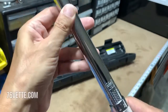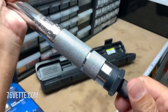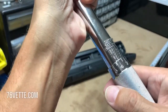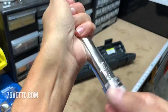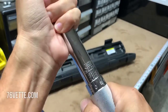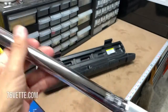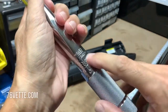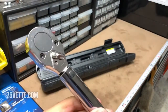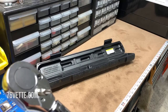This one is quite easy to adjust — you just loosen this bottom knob here. It's a bit hard to see since I'm behind the camera, but I like to set it at around 90 foot pounds for the mag wheels. Once you set your adjustment, you tighten this knob down to the bottom, and the torque wrench is ready to go.